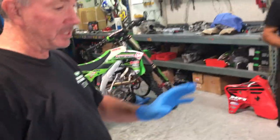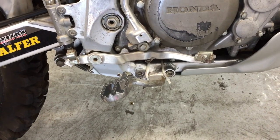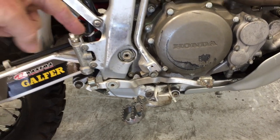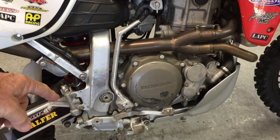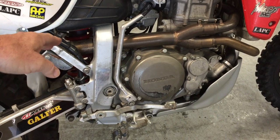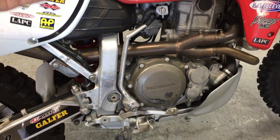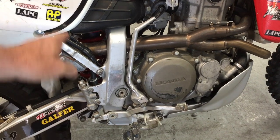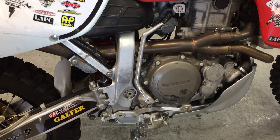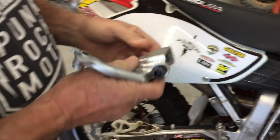Back in 2000 when they first came out. Back to Honda, they actually had a different piece they put in there. It kind of shaved the frame because they start to round off. It's almost like the rear bolt just wasn't strong enough — it bolts into the frame, and there's so much pressure that it would start to rock and round the frame. So they would plane the frame straight, put in a flat piece of metal and a new bolt to try to fix it. But when we started really looking at it, we looked for an even stronger method, and that's when we came up with this.